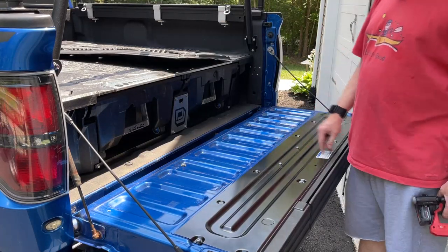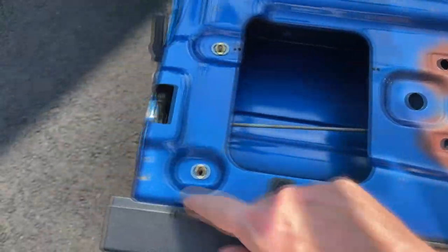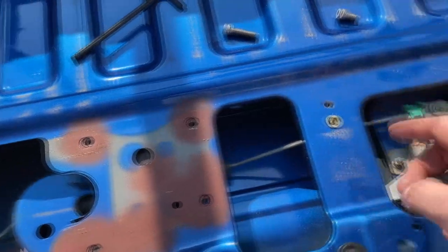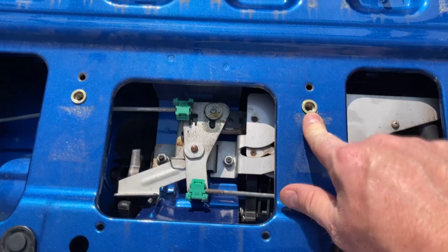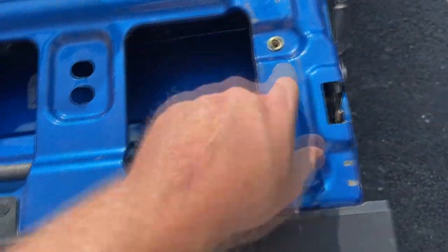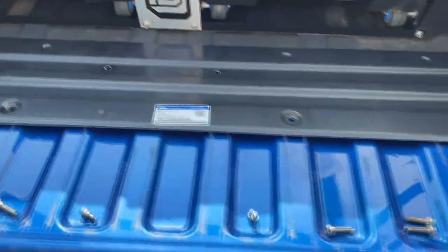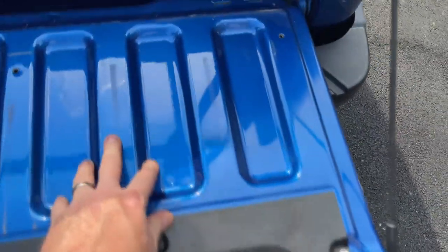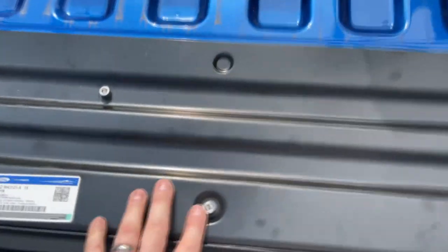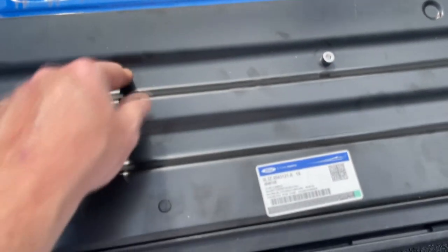So this will be a much better solution for me. I'm back at my tailgate again and my plan to use the old stripper pole screws to reattach the new cover plate has changed. Instead, nutserts are used with stainless steel Allen hardware. You can see the nutserts were all installed. This is a 2013 Ford Raptor and that is the part number for this plate — it fits perfect. There was no cutting, no drilling involved, except I had to make the holes a little bigger in order for the slightly larger bolts and nutserts to go in. These two Allen bolts are shorter than the others because the lock mechanism is right below there.